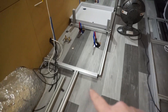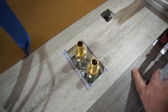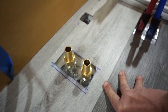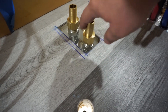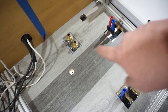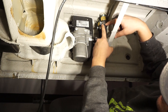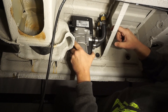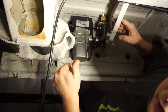From inside the van you can see where the fittings come up through the floor — we cut away just enough flooring to tighten everything down and leave room to hook up the hose going to all the appliances. Underneath the van you can see the fittings coming down through the floor with the antifreeze lines hooked straight into the furnace, all tight and locked in place.